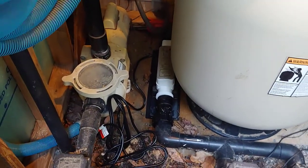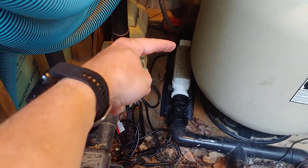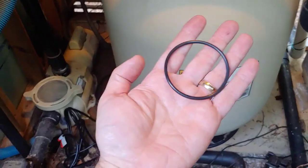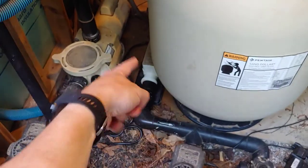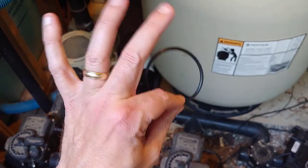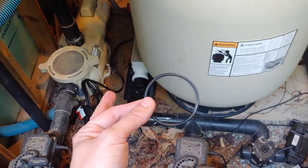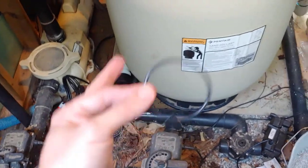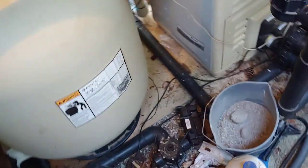We've got the new unit in place but not fully connected yet. I've connected the back coupling and put in the washer — the o-ring. If you're replacing this, it comes with couplings and new o-rings. Replace these; don't use the old ones. If you're not already having a leak you will soon, because these get old. If it's been five or six years, go ahead and replace them.